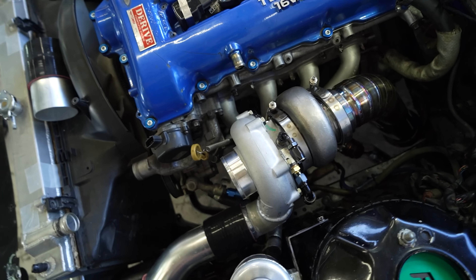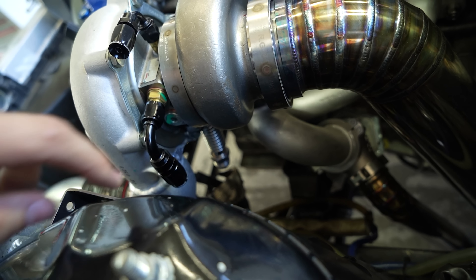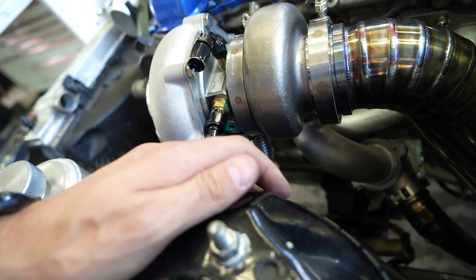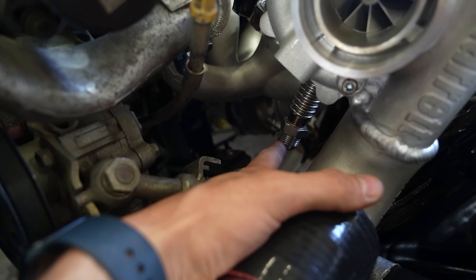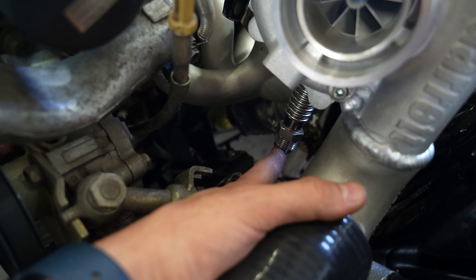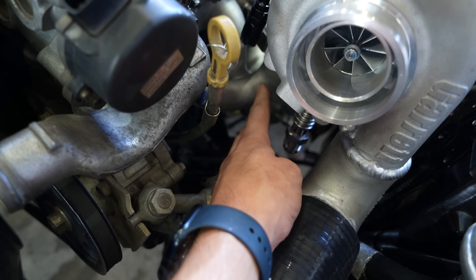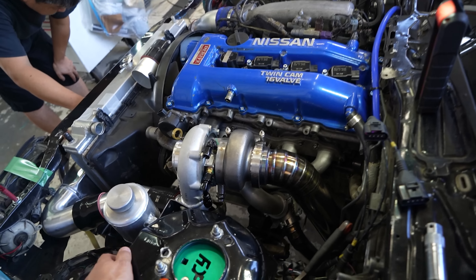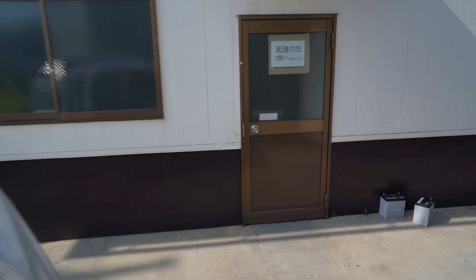It's a good idea to screw all your fittings on first before you make the lines, to make sure you have enough clearance. Some of these G-series with bigger profiles are really tight and you need tight radius fittings. I've already got my oil drain extension piece on there — the little flex pipe. I highly recommend one of these flex pipe things; you can buy them from PRP or GCG. They're amazing. They save you so much time because you bring your dash-10 fitting down and once you set it, you never have to touch it. It's flexible so you can pivot it in whichever direction you need for your drain.